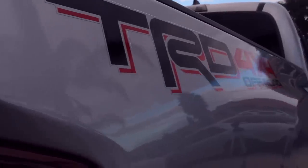That's going to complete today's video. With the exception of some of the plastic pieces, we got the paint looking brand new and clean. In total I spent about an hour to an hour and 15 minutes on the passenger side because there were so many scratches and they were pretty deep, and about 20 minutes on the driver's side. Just know it'll take a little elbow grease, but you can get your truck looking brand new. Also, if you use Meguiar's Scratch X or similar polish, don't use it as part of your routine — it is like sandpaper and you are removing part of the clear coat. Only use it when you get light scratches.